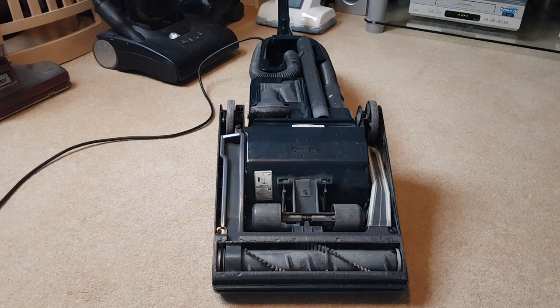You have seen this vacuum cleaner before — I've done a video of it when I got it from the tip, showing the suction and how it worked before I refurbished it. Now I'm doing it up. I've had the sole plate off before and found the belt had stretched, but I didn't have any Turbo Power 2 belts on me so I left the old one on. Then I found a new one in my spares box, so we'll see if it fits — there's no reason why it shouldn't.